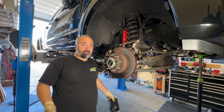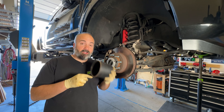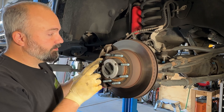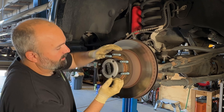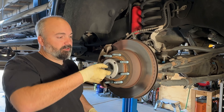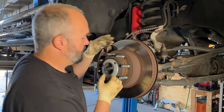I don't personally like that. I understand the auto hub should work, but should there be a case where you're off road and it doesn't? Well, you have to take the wheel off to get to it, or break the cap with the three little bolts inside — these bolts float so you can't unscrew them from the outside. So while we're here, we're going to manually engage the hub into the locked position. We'll spin the head in to the inside — yeah, there we go — and make sure that it's engaging. I can tell it's engaging because it's hard as hell to turn. The Tremor has the limited slip front diff, which means it's driving the other side, making everything that much harder. We'll spin it back to auto and it disengages. I like to do this a couple of times on both sides to make sure everything is functioning properly.